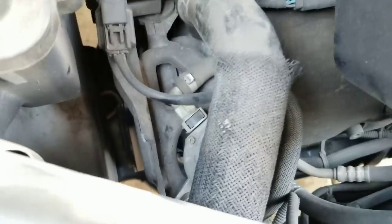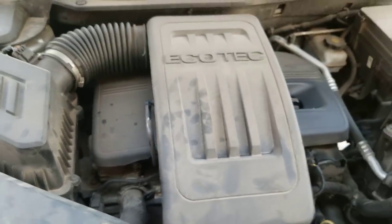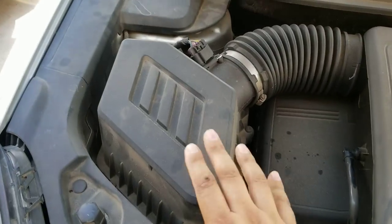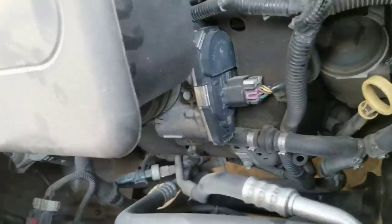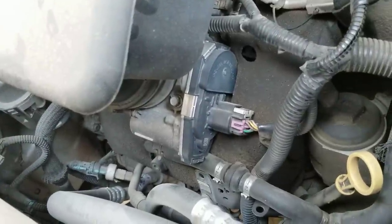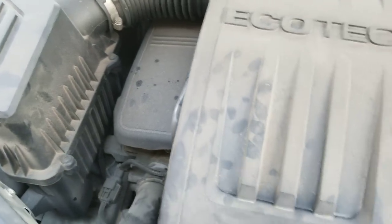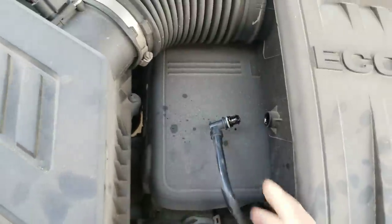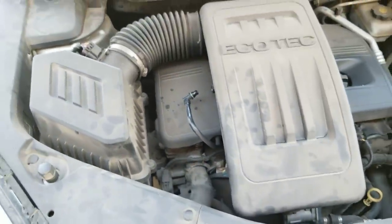This is going to be about replacing the alternator from the top, and this is how you do it. First of all, remove the engine shroud and the airbox. The engine cover comes off with a flathead screwdriver — loosen it on top of the throttle body. Then disconnect this hose and I'll come back for more.